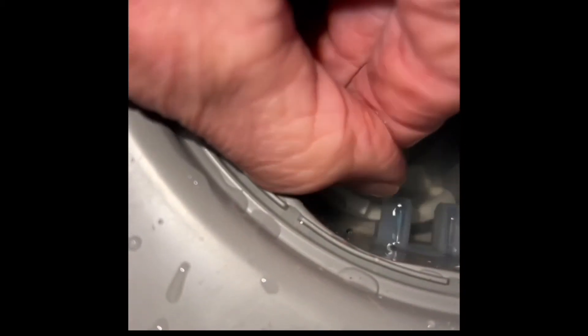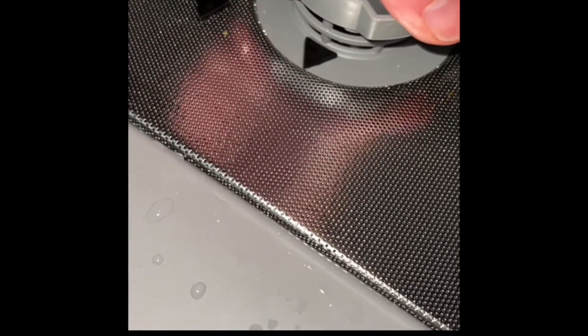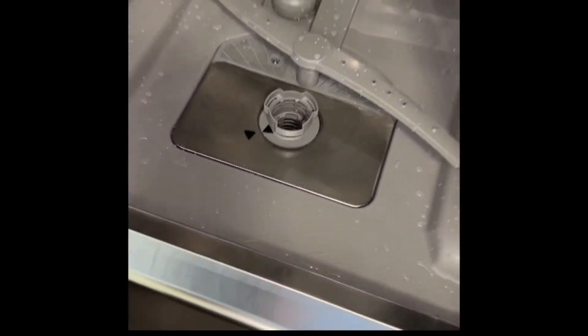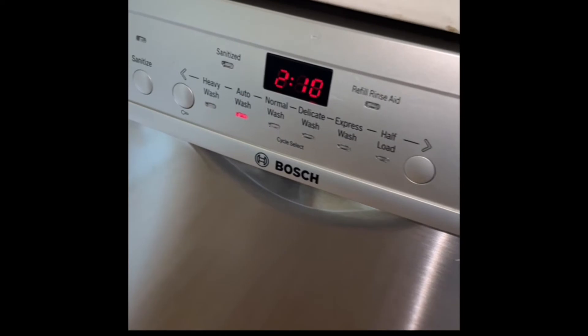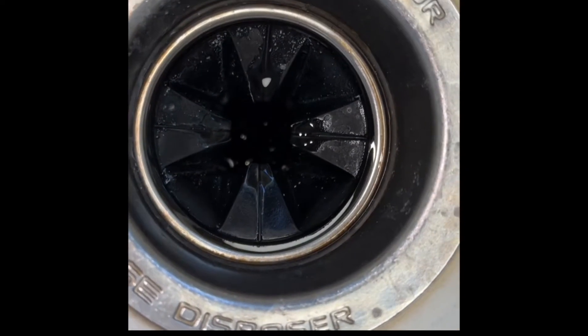Make sure you can hear that — push it in with your finger until you hear it click. That's great, it's in there nice and solid. Now put the filter back in: get the arrows lined up and turn them so they lock in and point at each other. That probably is going to solve your E24/E25 error. If you want to check, shut the door, turn it on with the power button, then press start. I can already hear draining from the beginning of the cycle — you can see it shooting out and hear it draining. That did fix it.